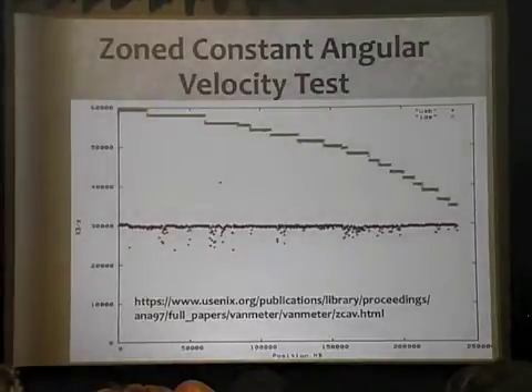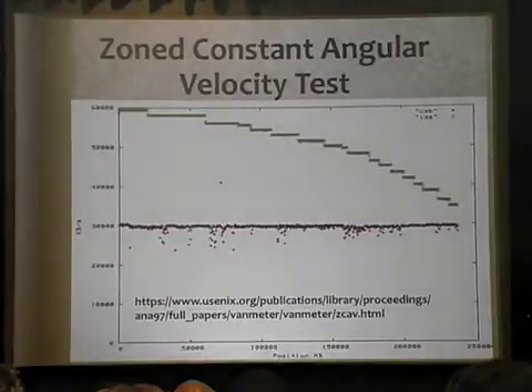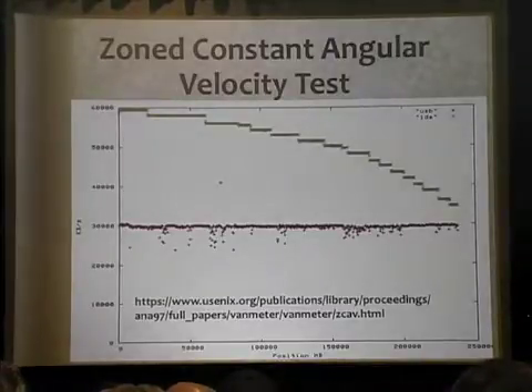If that tells you anything — at the slowest part it's still faster than the fastest part of that drive through USB. So it's going to be a lot more consistent from a speed standpoint, but it's going to be slower all the way across for USB versus an IDE cable. So you still might want to pay attention to that if you're actually optimizing for speed.